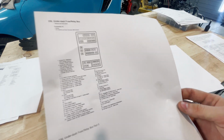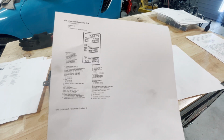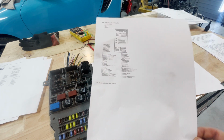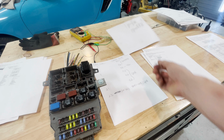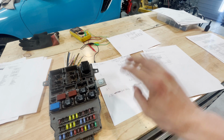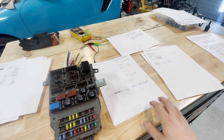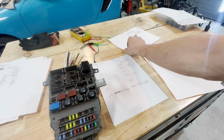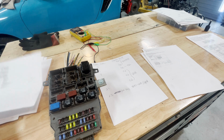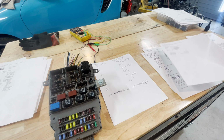All you have to do is just cut the connector itself, the white-green wire, and give it 12-volt power. Of course, you probably want to fuse it, but you just need to deliver it 12-volt power, or you can just connect it right back on the OBD port, and that would be the white and green wire in the corner. So you have two blacks in the middle, and then white and green wire in the corner. It's pin 16. That's going to be your 12-volt power supply for your scan tool. And so you could just power it right at the OBD. And of course, you're going to want to fuse it, but you can, again, just do that right at the OBD.